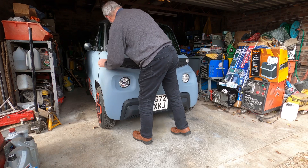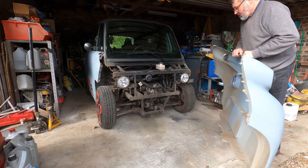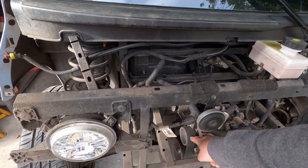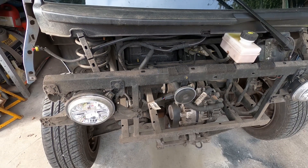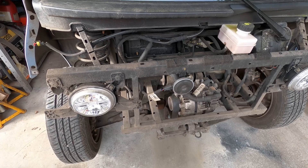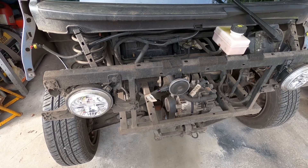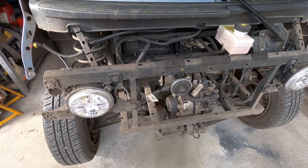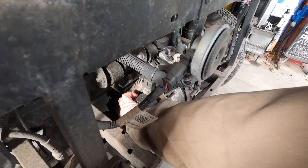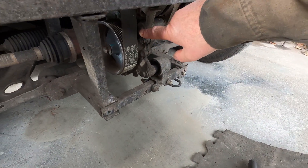Right, it should just come off. So I need to get that belt removed. It's just two big bolts that go through that need to be slackened off, and hopefully there's enough stretch in the belt to get it over the pulleys when it's fully unadjusted. There's a T-50 Torx there and a T-50 Torx there that need to be slackened off.